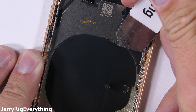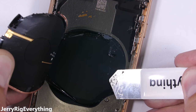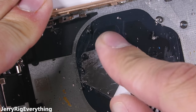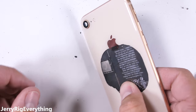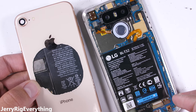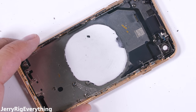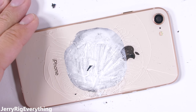The back glass of the iPhone 8 handles most of the heavy lifting when it comes to keeping water out, as long as it's not cracked — especially cracked over the top of the wireless charging hole. Now that we have this hole exposed, let's try to make it clear really quick just to see what it would look like through that window. It's pretty much the same concept as the clear Samsung phones — a lot of scraping, but no paint stripper required on this one. One of my least favorite parts of the iPhone 8's build is the way Apple attached the back glass. They could have done it in a way that was easy to waterproof like Samsung and easy to replace, but they didn't. They made it permanent, and the only way to replace a cracked back panel is to break it out with force — and that's a lose-lose situation for everyone involved.